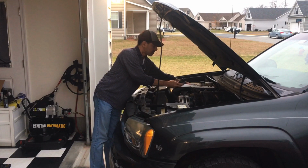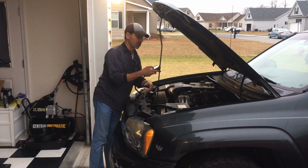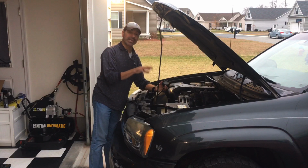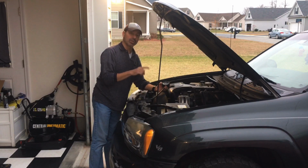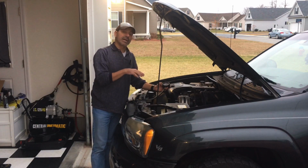Okay, well, this pretty much wraps up this video on how to diagnose a bad or failing fuel pump. As we saw here, we definitely have one that's not completely gone, but it's definitely not performing the way it needs to, so it needs to get out of there. Fuel pressure is about 10 psi below the minimum, so that has to come out. So that's why it's so important to diagnose it properly.